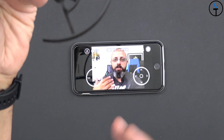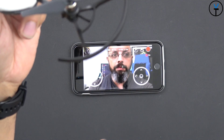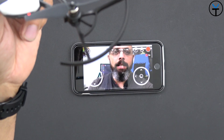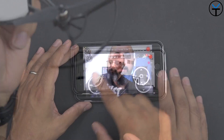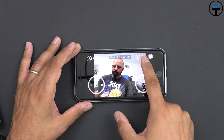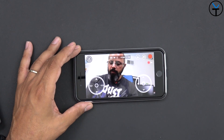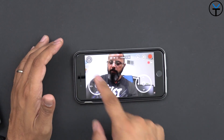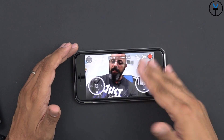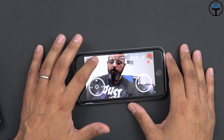This is the camera view showing image quality. It has a picture mode and a video mode — in video mode it fills up the screen. The 720p transmission looks really nice. I'm testing with the iPhone 8 Plus. The controls are simple: standard joystick controls on the left and right, with buttons to switch between photo and video. Automatic takeoff and landing is a one-button option. It has a tilt warning — if the Tello isn't flat, it won't take off — and a heat indicator that will land the drone if it overheats.